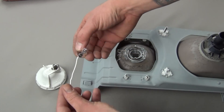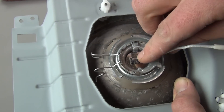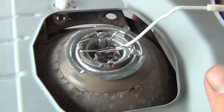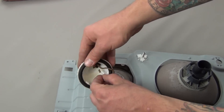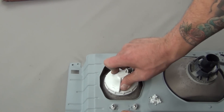The high beam bulb is also directional. Pay attention to the cutouts in the base and seat it in the proper orientation. For the high beam bulb, secure it in the housing with the tension clip. Attach the brown ground wire to the open terminal on the lens housing and plug the white wire from the bulb into the housing cap. Rotate the white cap onto the lens housing.